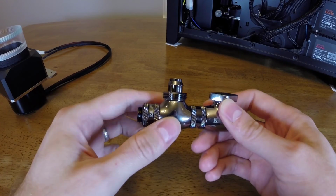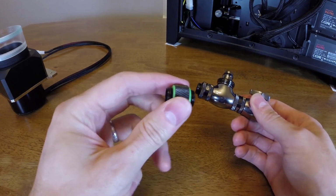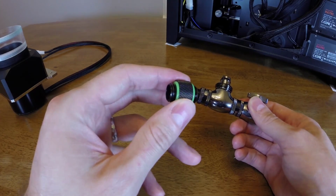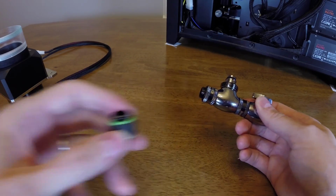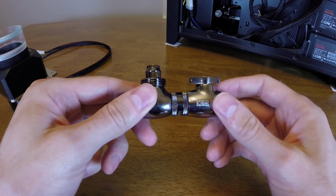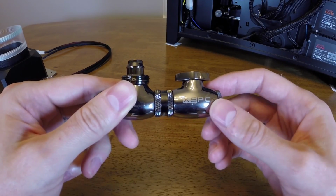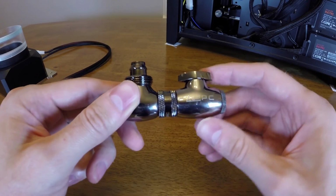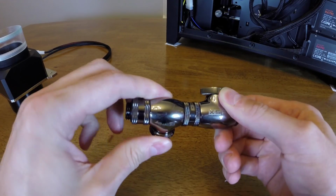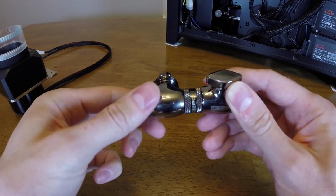super helpful, and I recommend using them in pretty much any situation where you might need a straight-through male to male connector like this. If you have the money, I would say just get a rotary connector instead. They're a bit more money, because they're technically two separate pieces with some O-rings inside them. Make sure you get the rotary kind so that you don't have to worry about how your fittings are positioned once they're tightened all the way down.